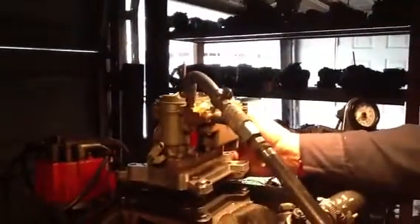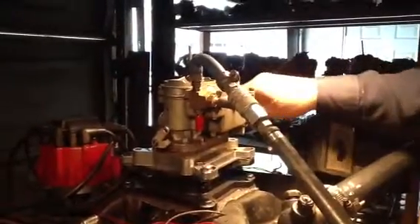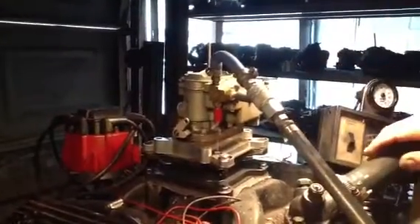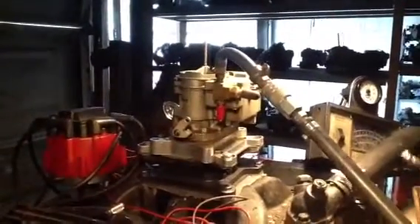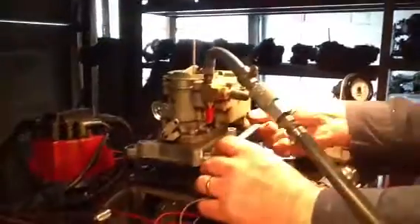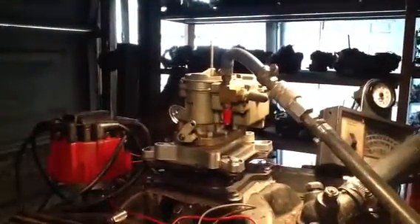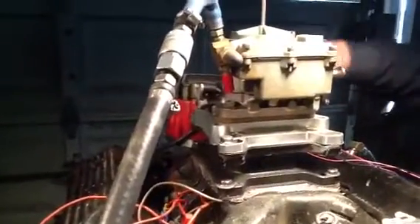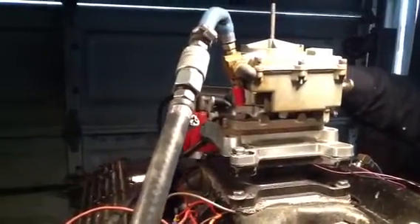All right, let's get the heat off you. I bet you can see what's wrong. In an all-right situation that carburetor would probably work, but trying to run it around town at less than, you know — this should come in about three-quarters throttle. But as you can see, it's just like the front one — way lean, or the center one. I would imagine the other one's gonna look just like that too, but we'll take care of it. We'll get it to run about 2,000.